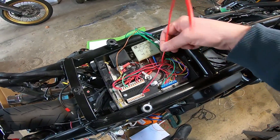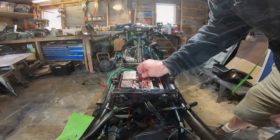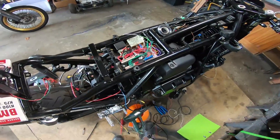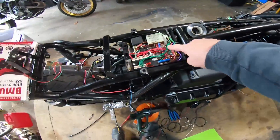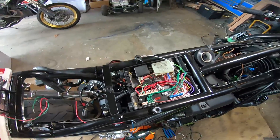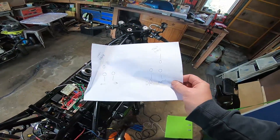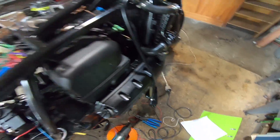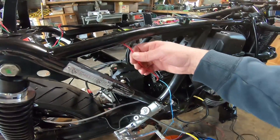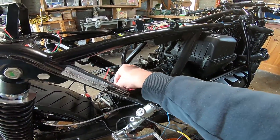We have connected all the button cables — all these green ones coming back to their appropriate inputs — and we've drawn up exactly what we want. Now I'm going to do the alternator. This big red heavy cable goes directly to battery positive, and this blue one is for our charging lamp.